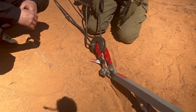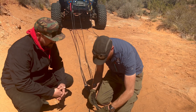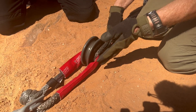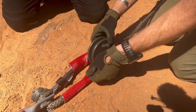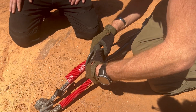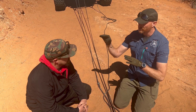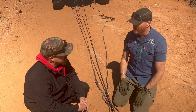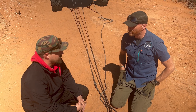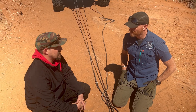As we started to tighten up, I saw the whole system starting to bind, and we noticed that this had actually fallen out of the groove. The correction: come down here while unloaded and get it back in the groove. The cautionary tale is, until you get some load on there, watch your junctions and make sure that doesn't happen. All rings out there will suffer from the same thing — you've got to make sure everything stays in its groove and stays in its place.